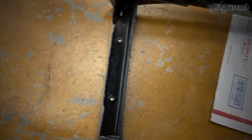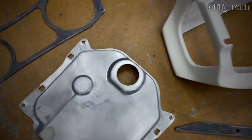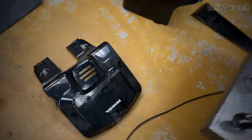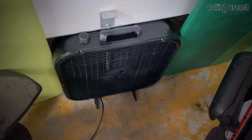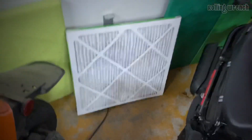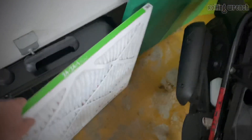The part I hate the worst is prepping, getting her dialed in. Once it's nice and smooth we can primer it and then paint it. Here's a little hack - I'm going to make a little makeshift paint booth with a box fan and a HEPA filter in front of the box fan, so paint particles aren't going out and landing on cars and whatever else is out there.